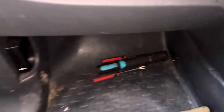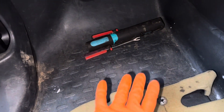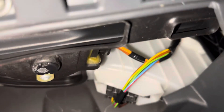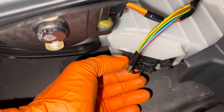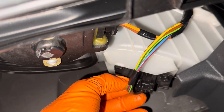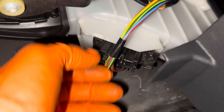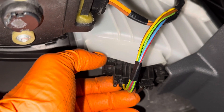If you go under the passenger side — obviously this is UK — passenger side footwell, this plastic cover will be up here. You've got a couple of little plastic clips, one here and one there. Take them out, and if you look up under here you can see the resistor ballast and a wiring loom. This is loose as I've already removed it, but to remove it is a bit of a fiddle. You've got this little tab here which you need to push in.